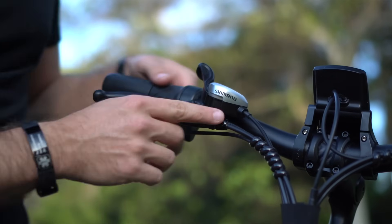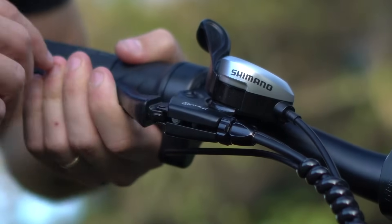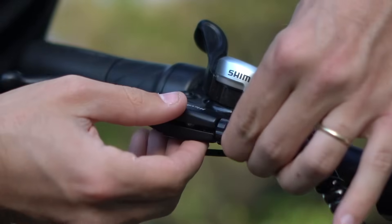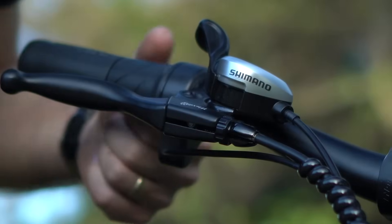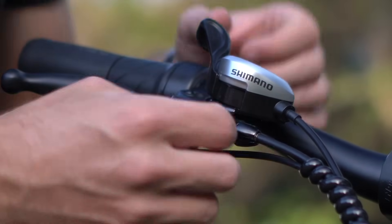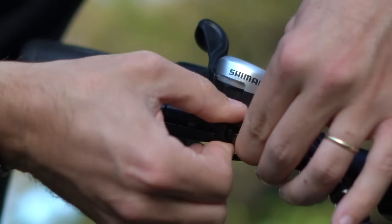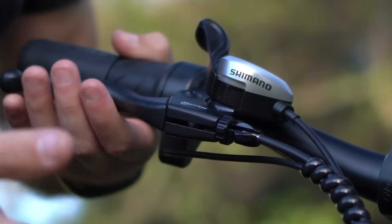It starts with minor adjustments you can make up at the brake lever. As you start pulling your brakes over time that cable stretches, you wear your pads a little bit, and this lever will get closer to touching the bar. To get yourself more space, you'll slowly open up this barrel adjustment here, give it a couple turns, then slide this stop back to lock it in place. That pulls a little more cable and gives you more time before you have to make a macro adjustment. You can go several turns, but this is just a stopgap measure that can buy you some time over a few months.